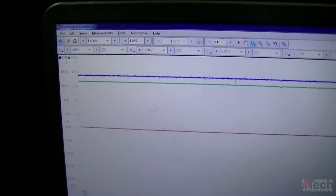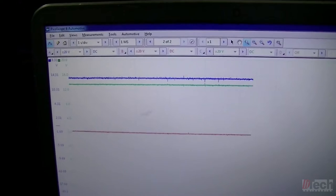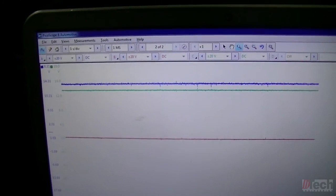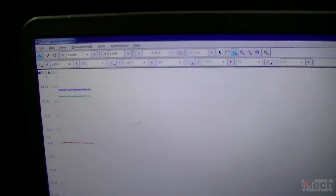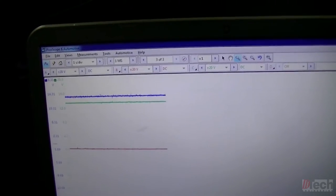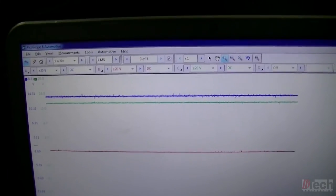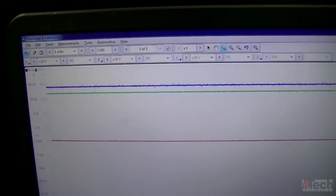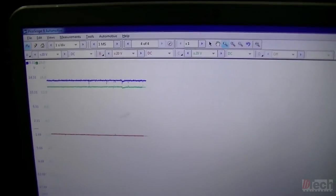So there's a shot of the Pico. Signals are there, key is on. I'm assuming almost similar to the wheel speed sensors. Once we start rolling, if any of those four pulses are being generated, seen, received, or sent, they'll show up on the screen here. So I'll do the same thing, start backing out, see if we go fast enough to catch a signal.